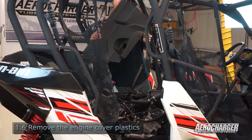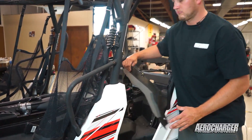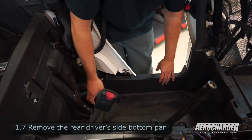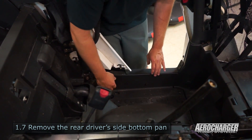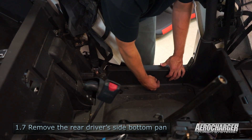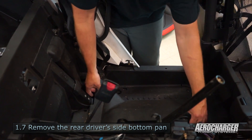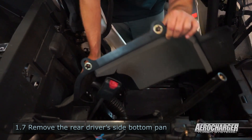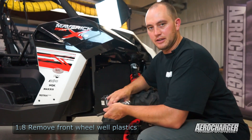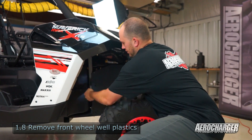Next we're going to remove the side rear plastics — same thing, just plastic darts holding them. I've already removed both sides. To get to the clutches, you're going to have to remove the bottom pan over on your driver rear side. After you remove all the screws, you'll have to peel it up. To loosen your seat belt connecting bolt — it's a 10mm — you'll have to get around on the back side to the 10mm nut. Once you loosen that up, you'll be able to slide it out. Then remove this inner piece of plastic on the front on both sides — you've got two 10mm bolts.